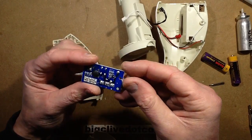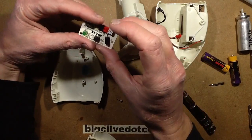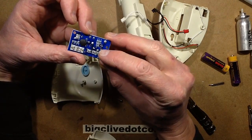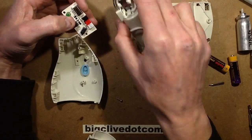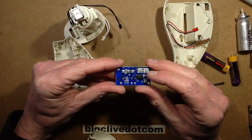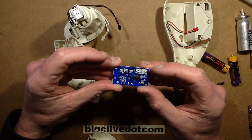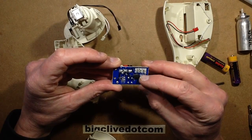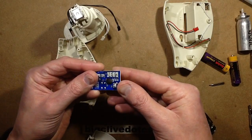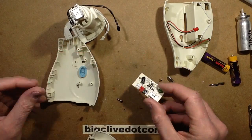It's got a green LED and a big diode — is that for back EMF protection? That's an unusually big diode. The power comes in on the red, and the diode is actually connected across that little valve, so it is a back EMF spike suppressor for the solenoid valve. That must be quite a high power little thing. There's also a transistor down here, probably for switching that, plus a scattering of resistors and a capacitor, probably for timing. There's a switch that goes straight to the chip as a digital logic input to show what setting it's currently on.